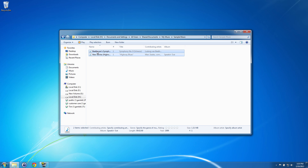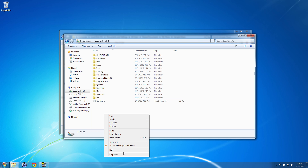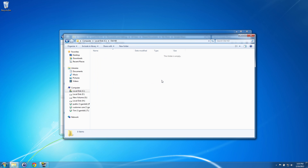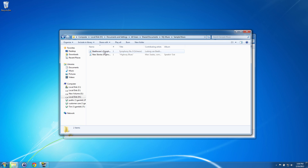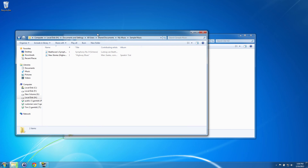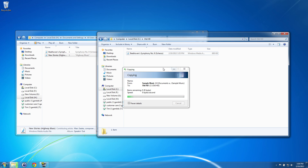There are two different ways to copy files. We can either select files, then right click and go to Copy. Now we can open a new Windows Explorer by going to Start and clicking Computer or My Computer. Then we would pick our local hard drive and make a new directory — I right clicked on a blank area of the screen, went to New, went to Folder, and I'm going to name this 'old hard drive' and open it. Then I right click again on the blank area and click Paste. That's going to paste from my old hard drive to the new hard drive — and that's copying the information, so it's not removing it. The old hard drive still has that information there.